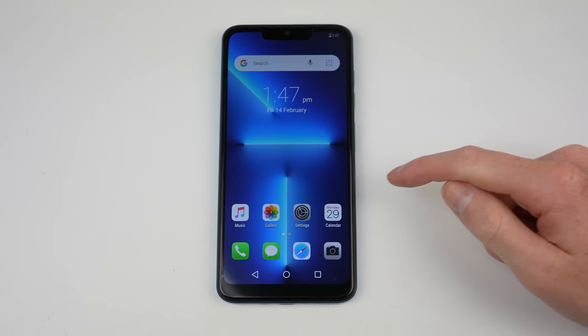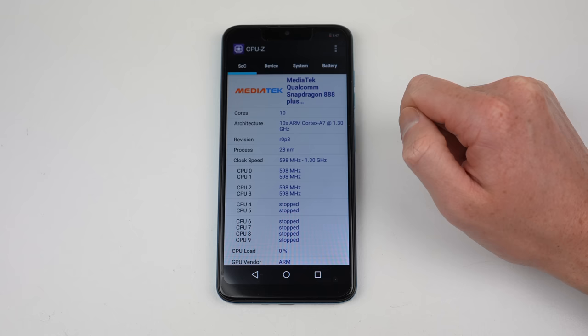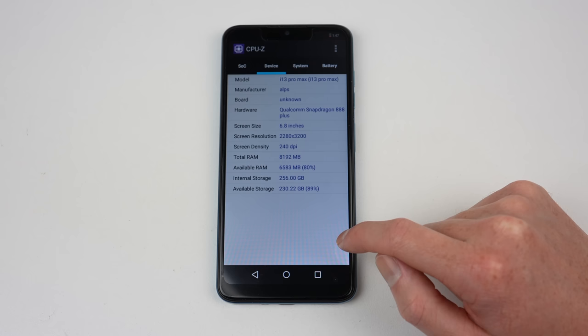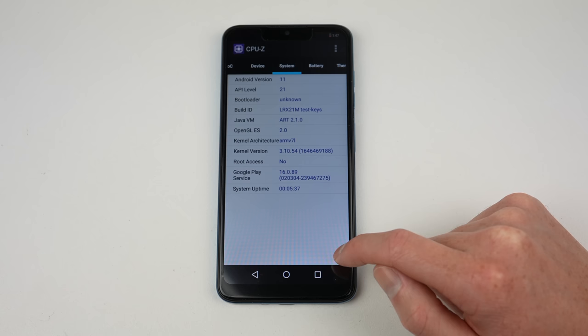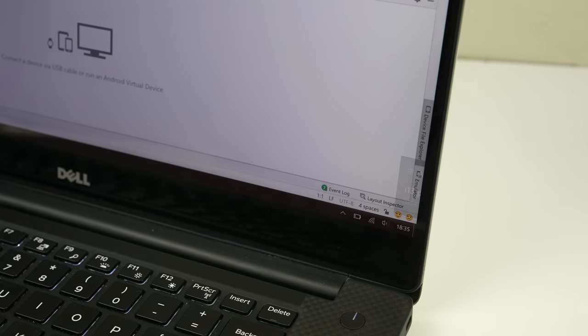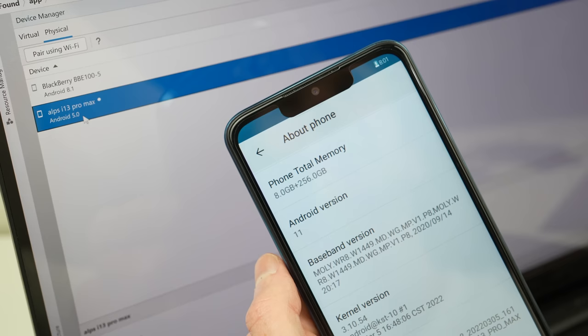I fired up Geekbench, which should provide some detailed insight into the phone's hardware — and I'm right, something is up. It's reported as having a MediaTek Qualcomm Snapdragon 888 processor. MediaTek and Qualcomm are two different companies — that's like saying this phone is an Apple Samsung 13 Pro Max Ultra. The storage still displays as 256 gigs, with the display also reporting a resolution of 2280 by 3200. Most interesting, however, is the OS and API level: Android 11 should have an API level of 30, meaning this phone isn't running Android 11. After enabling developer options and USB debugging, and even I was wrong thinking this was Android 6 — on my computer, we've uncovered it's really Android 5, that's 8 versions behind the current release.